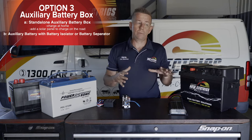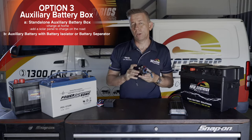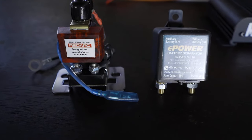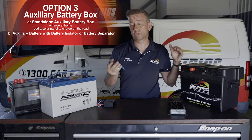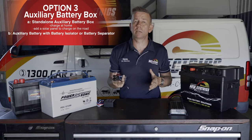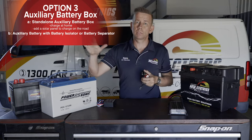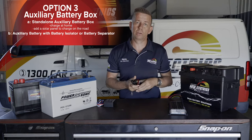Option number three is to have a battery in the vehicle with some sort of isolator. You wire from your start battery through an isolator — there are many on the market — to your auxiliary battery. When your car is running the battery will charge, so if clouds come over or someone leaves the fridge lid open, you start your car, the battery charges. Turn the ignition off and the system splits: start battery sits there fully charged, auxiliary battery charged up and running your fridge.